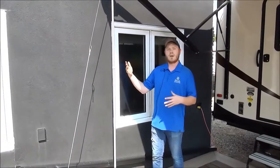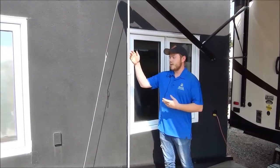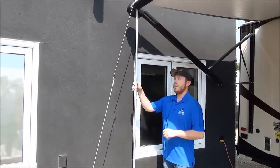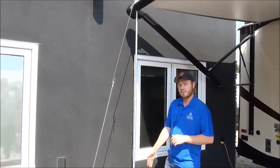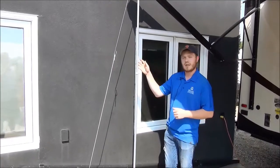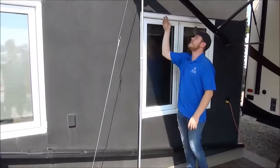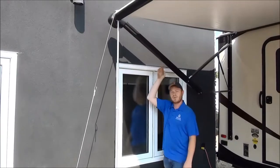Something you can do to solidify your awnings and reduce the amount of damage you see is adding these electric awning support arms. These are made by Imatec. They actually wrap over top of your roller tube and stake down to the ground. They also come with a set screw so you can set your height, and a guy line which will help support it overall. As you can see, it's going to reduce the amount of that up and down flapping that's going to wear out those components.